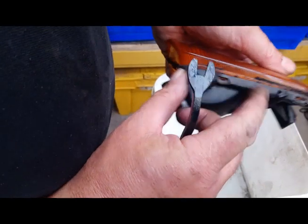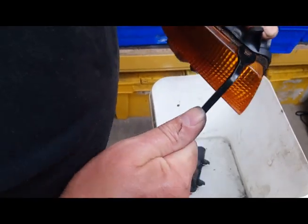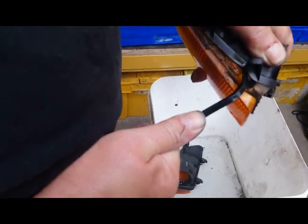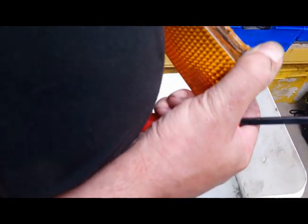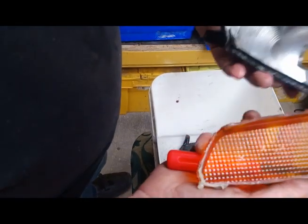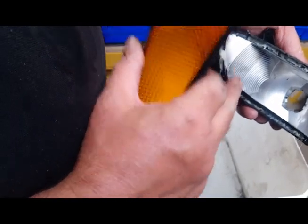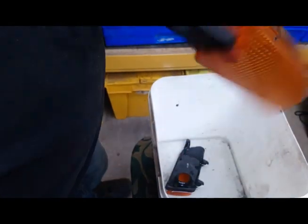You can see these pieces here — these are actually like little clips, and these are where the glue goes in. Just ease it up and then pull the lens out — just like that. And there we go, the lens is now unstuck. I'm going to clean all this up and then we can see about putting the white lenses on — so we've got nice white lenses instead of horrible orange ones.